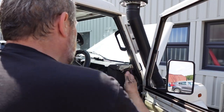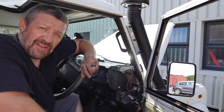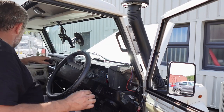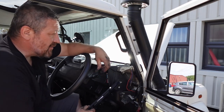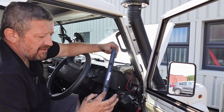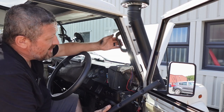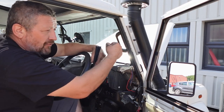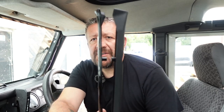You can just see how nice it fits on there. If you've got a side step, rather than pull yourself up on the steering wheel, you can grab a handful there — it's plenty strong enough. I'm 18 stone and that is not going to budge at all. The only problem I have with it is that I wanted to fit the extra deep A-pillar channels onto my vehicle because I'm going to have additional wiring going from front to back. Unfortunately, you can't run this handle with the deeper A-pillar unless you source your own longer screws, but then you're adding quite a lot of torsional stress. So unfortunately you're going to have to choose — is it going to be the handle or the extra deep channel?